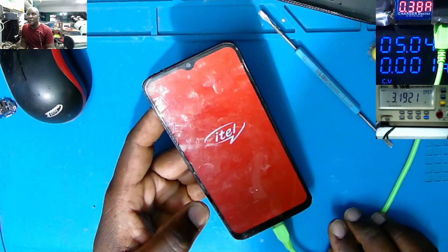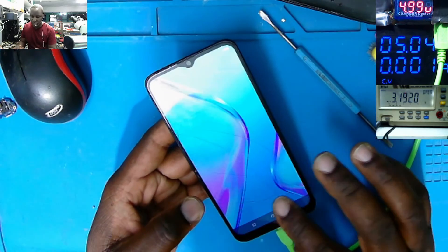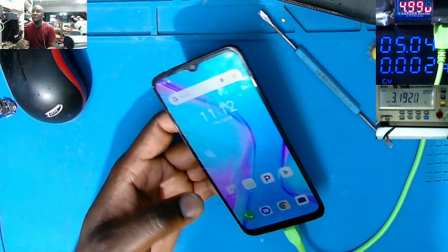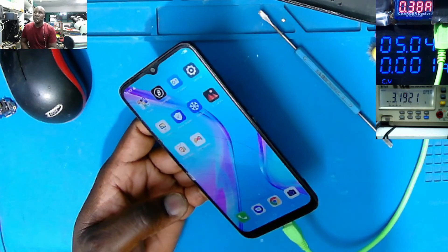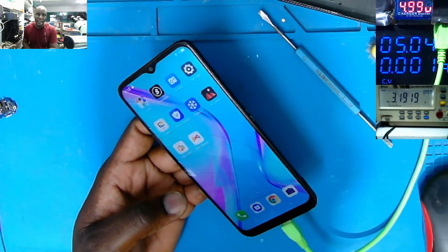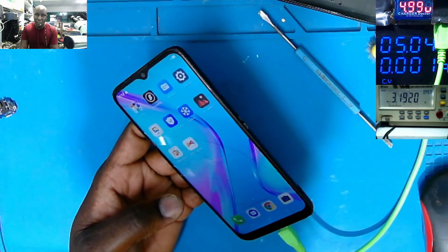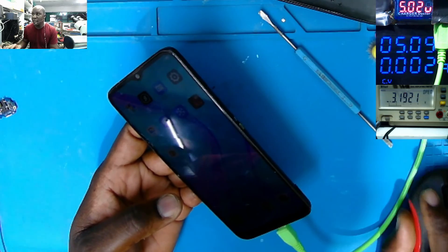So that's how you can diagnose and fix a dead phone. The phone looks working — IT is working, everything is fine. Subscribe and don't forget to turn on the notification bell. If you plug in the charger and the power meter goes off, it means something is wrong on the flex charging panel — mostly you have a shorted diode to ground. See you on the next one, bye!